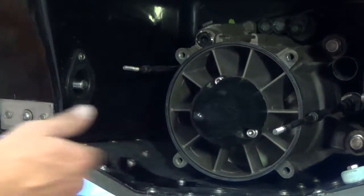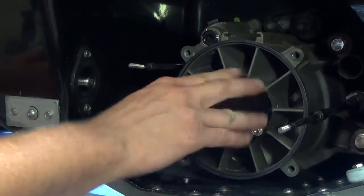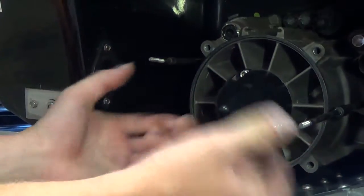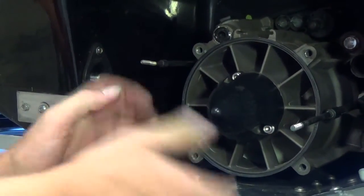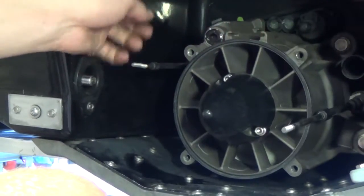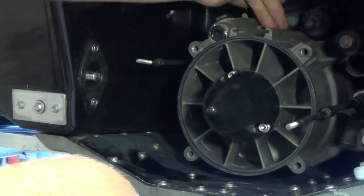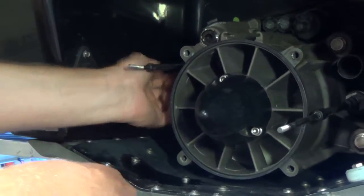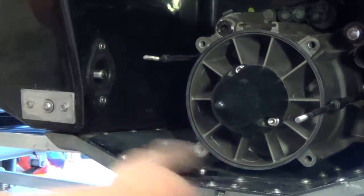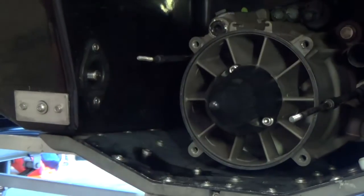But as I mentioned before, this jet pump here is similar to the ones you'll find on most of your models of Yamaha and Kawasaki. So you can actually watch this video in reference to when you're hooking up to those. One of the main differences, especially on the Kawasaki, is that on here it'll actually have a little line. The bilge will be coming off of this side, and it hooks into the Venturi nozzle just like this here on the Sea-Doo. But that's a rubber line on the Yamaha, so you'll take that line and actually pinch it in half and put a zip tie around it so that it doesn't take on water and sink your ski. Just be sure to periodically check that as well, just like you would with any of your other thrust adapter pieces.